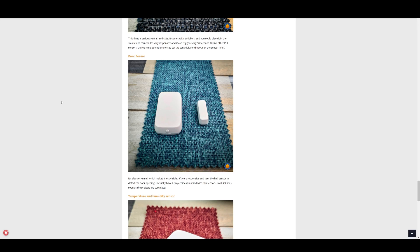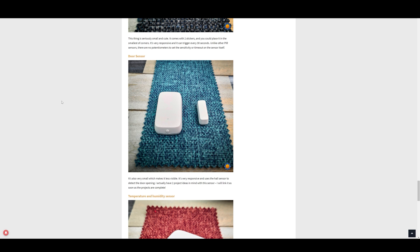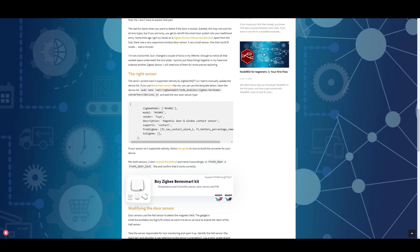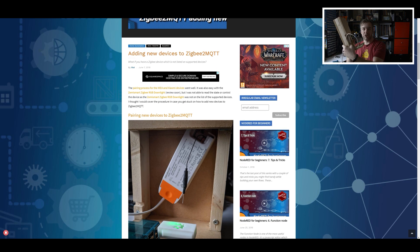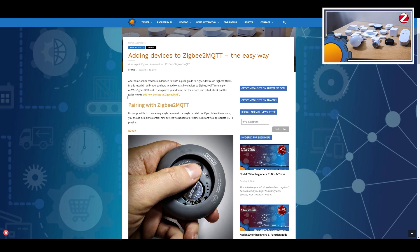I've used Benek's smart door sensors to create my smart door. The door sensors are quite small and that gave me the idea that they would probably fit in the door frame. I've used these particular devices and I've linked them in the description of this video, but if you want to use any other sensors, that's fine as long as you can bring them to Node-RED. Because these sensors weren't available on the Zigbee2MQTT device list, I had to add them manually by editing the device.js file. If your device is already on the list, all you have to do is power it and bring it over to Node-RED — I have a tutorial linked for you as well.